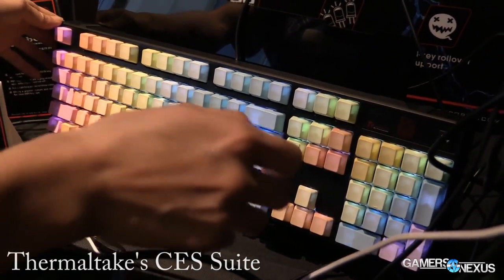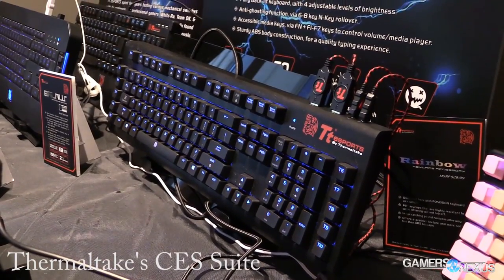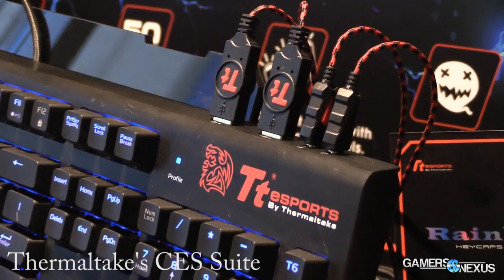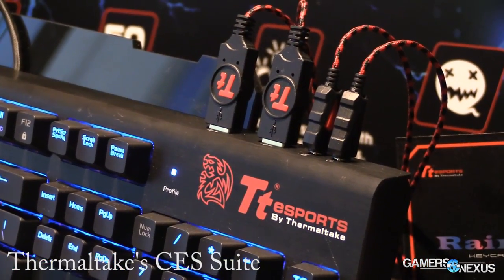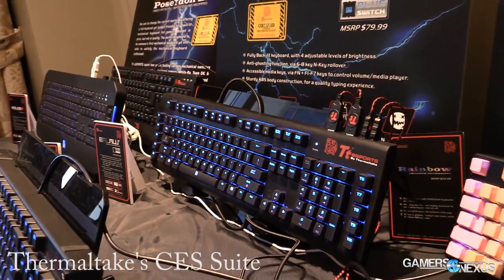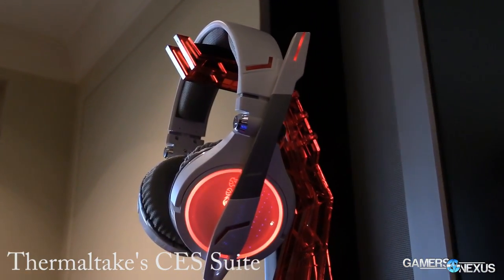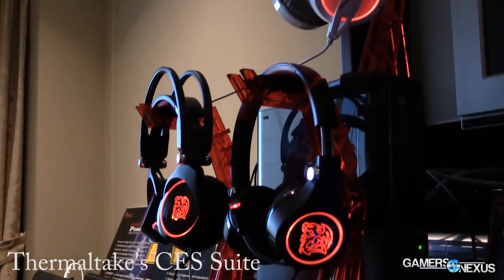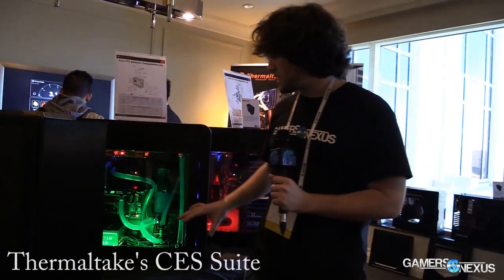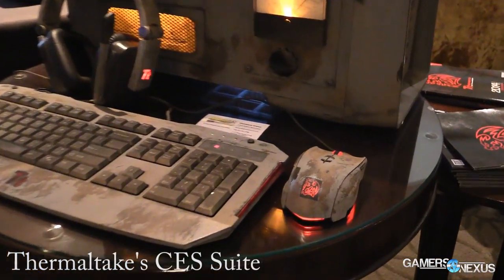The blue switches are very clacky. If you like the clackiness and you want to feel like you're in a press room from the 50s, then you'll like the blue switches. If you want something more damped and something more favored by, for example, StarCraft II pros, you should look into the brown switches — they're going to be very close to Cherry's brown switches. In terms of feel, it's using the normal sort of sloped cylindrical caps, so pretty standard key caps. Everything feels fine — the keys aren't spaced or sized weirdly, so you don't have to relearn the keyboard. The tactility is good, there's a lot of kick. When you push it down it kicks back kind of hard, which is really nice if you're doing a lot of typing. That rebound sort of helps you jump from one key to the next.